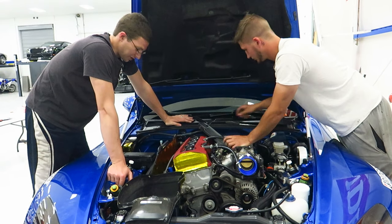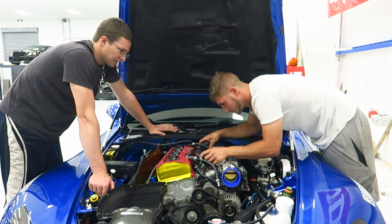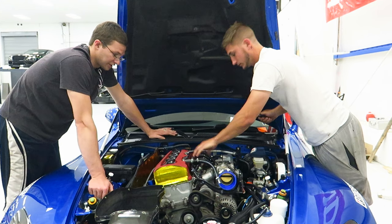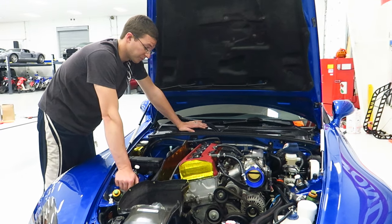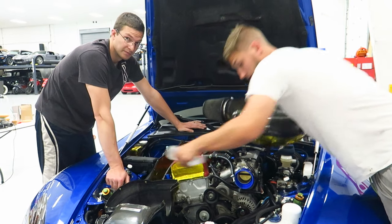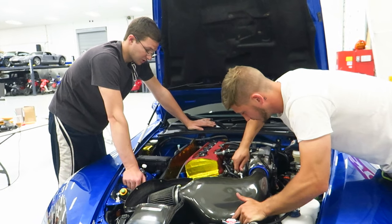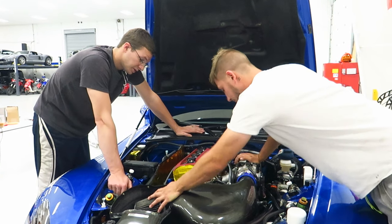We took it out for a test drive after getting the alignment right just to make sure it drove straight down the road. Everything felt good, but when I came to a stop we had a little bit of a misfire — apparently the car has been doing that for a while. We did a quick leak-down test and unfortunately, like these '06s like to do, it's got some burnt exhaust valves — one on cylinder one that's pretty bad, and a little on cylinder two. I pulled the valve cover and adjusted the valve lash, which really wasn't that bad. I like to run 10 thou on the intake and 12 thou on the exhaust, which is definitely the looser end of the spectrum. We're not going to have time to get to brakes today, but at least we know the lash is good and we'll come up with a game plan to get the cylinder head rebuilt.